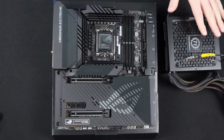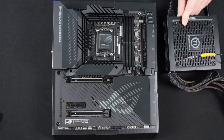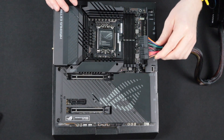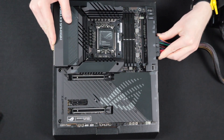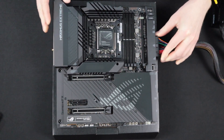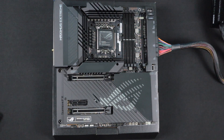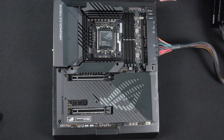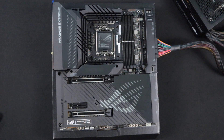Next comes the fun part. We're going to put power from the power supply into the motherboard through the ATX power port. We're going to power off our power supply first so we don't have any power flowing through the cable when we plug it into the ATX port. The connection click is audible and you want to make sure that you do hear it — that way there are no issues with connections and we are not creating any excess heat with the potential to burn a connection from all the power coming through these cables. I'm going to go ahead and switch the power supply on.